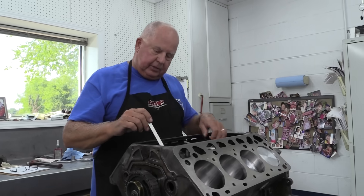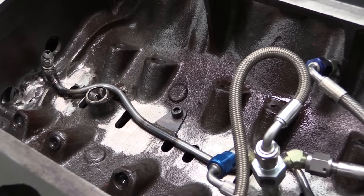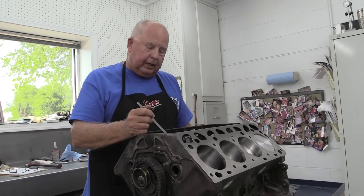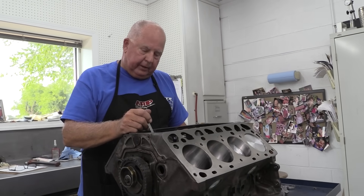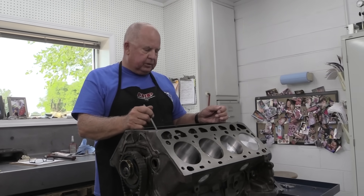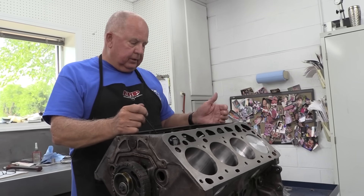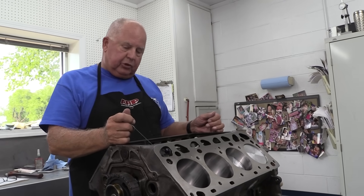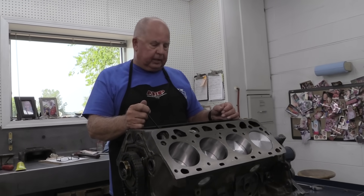This hose is feeding a steel log that is drilled to spray oil on each lifter and cam lobe to prevent wear. We used a similar thing for some NASCAR engines when we had to run flat tappets, to get a spray right directly onto the lifter and the load contact area. We had some wear issues even on stock cam shapes, especially on performance cams with more lift and spring tension. So I thought, why not do the oiler? Even though this is a stock engine going in a '55 T-bird being restored, it's not that much effort and it'll pretty much ensure long life for the cam, lifters, and rocker arms.